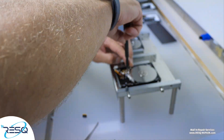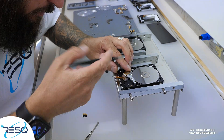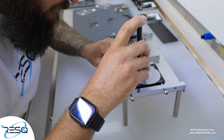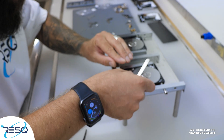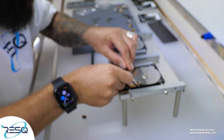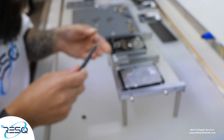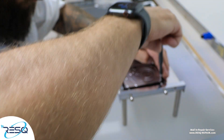Unfortunately at this point our autofocus was failing — it was focusing on me and not on the drives or my arm. I'm very sorry about that; I promise in the next videos I will give you better video quality. So after the head swap we just need to reassemble the drive again — just two or three screws are enough — and after that we go straight to our PC3000 portable.